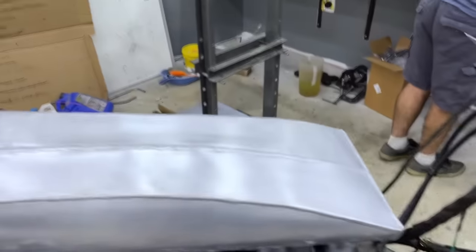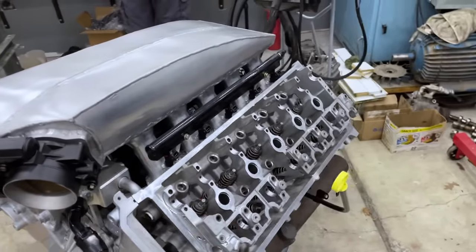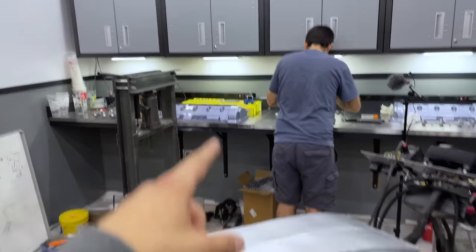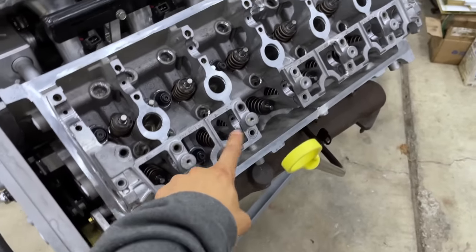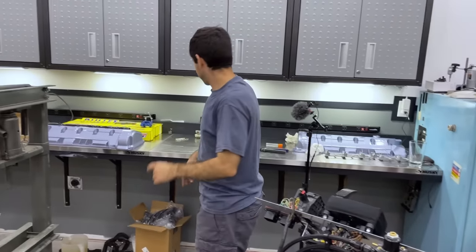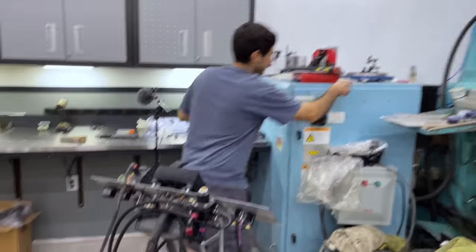All done drilling out the bearings we needed to — the holes now line up. Now the moment of truth: we're going to take those camshafts, bolt them up, and we're going to have to clearance all these caps because we have all the lift. Let's get some assembly lube and drop the cams in for the very first time.